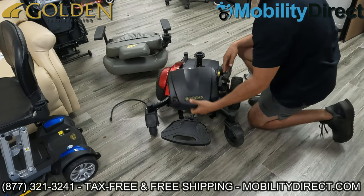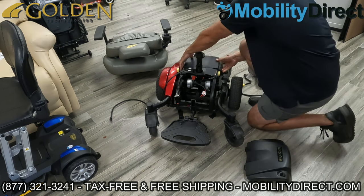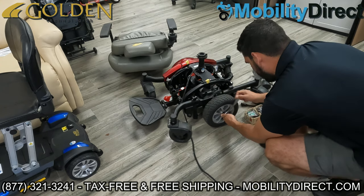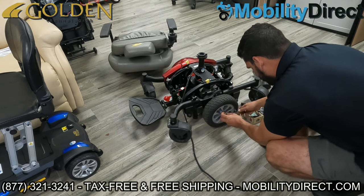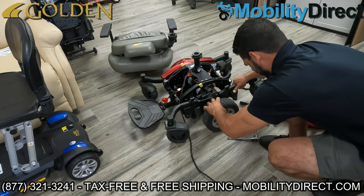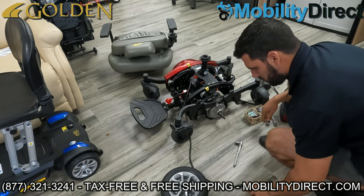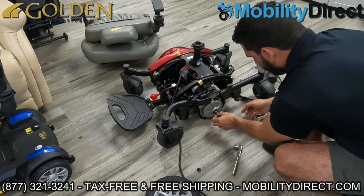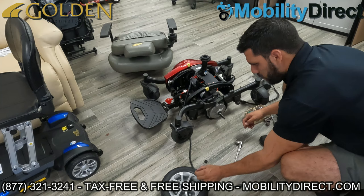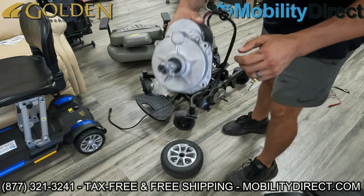I'm going to go ahead and get started with the motor swap now. What we need to do first is remove the battery compartment covers — it's pretty straightforward to remove those shroud covers. The next thing you're going to need is a socket wrench to remove the axle bolt that holds the tire in place. Be careful when you remove that tire; there are a couple of things that are going to fall out, like the bolt, a washer, and there's an axle key which allows the wheel to rotate with the transaxle motor when the axle is spinning. So make sure you keep it — don't lose it, it's very important.